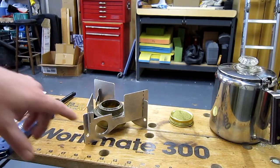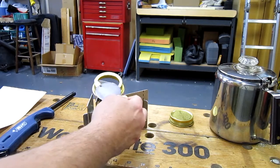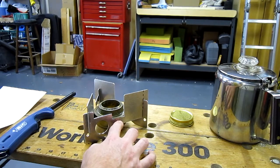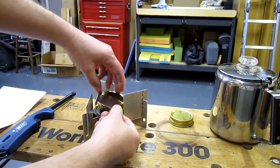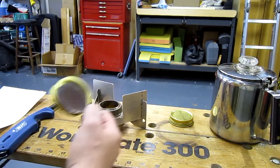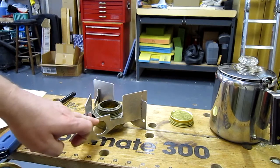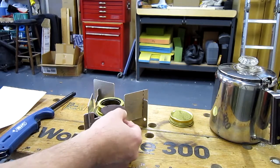I also wanted to point out that the reason why I brought this notch down as well was so that the simmering can be properly used. If you just bring the middle notch down to lower the burner and leave this up half an inch, obviously this is going to conflict — the lid won't be able to be utilized as easily and will end up cocked to the side. So whatever you do to this notch, be sure to do with this one, and that will retain the usefulness of your simmering.